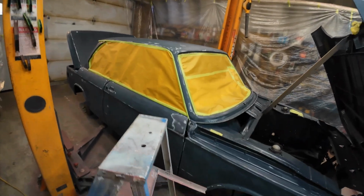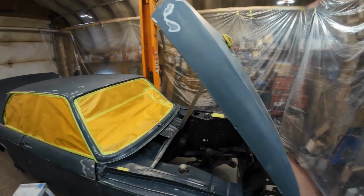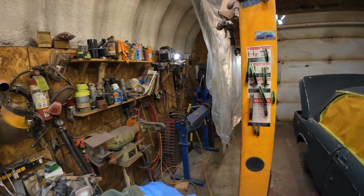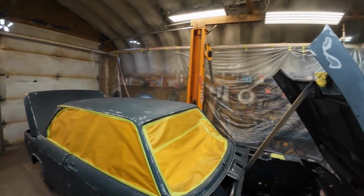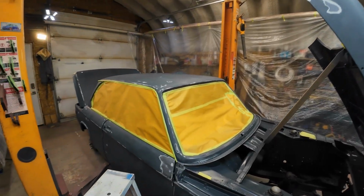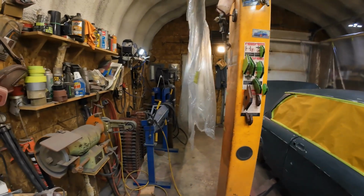Yeah, slowly getting ready for painting here. I went over half the car, well, the top portions of the car with the tack cloth, and I've let down my paint booth. I'm going to take an air gun and just blow on them a bit to release any dust from it all, and then I'll tack cloth the car again. Then we'll see about getting started here.